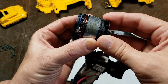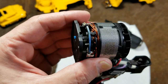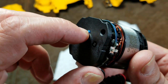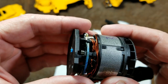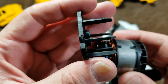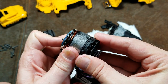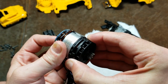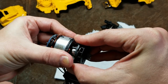Let's see if I can pull out this rotor — sometimes they really do press in the bearings and I don't like to yank them too hard. They have a real interesting design: this cap is a pretty tight fit and has a little rubber vibration dampener. You just have to pull and wiggle the back cap off a little bit. Interestingly, they have integrated winding separators and retainers built into this back cap. Now we can get this rotor out — there are really strong magnets in this so you do want to be careful.